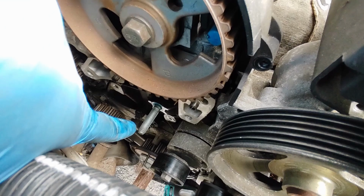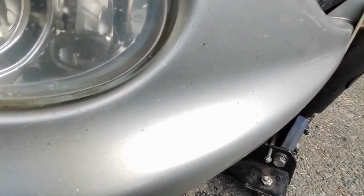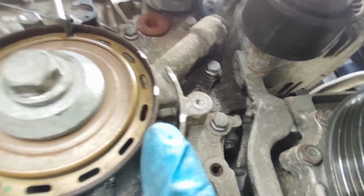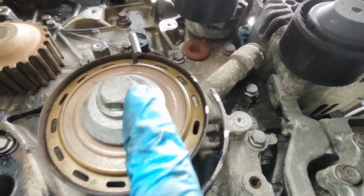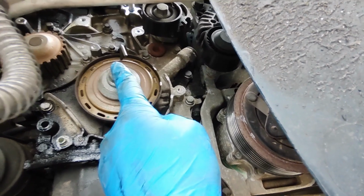There was a pulley there, tensioner was there. Let's go down here a minute. So we have the water pump just there, we've got this, and these marks you'll see are out of line. Yeah, that's because I messed up. I tippexed it while the belt was on and then realized that that pin wasn't quite straight, so I now believe that this car was originally one tooth out on the timing, because that is now perfectly timed and the top is perfectly timed.